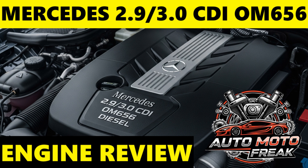Newer engine still maturing: as a relatively newer engine, long-term reliability data over very high mileages is still being accumulated, though initial reports are generally very positive. Camshaft and rocker arm issues: some reports on earlier OM656 engines, similar to the OM654, have noted instances of camshaft or rocker arm wear, sometimes leading to a ticking or knocking noise. Mercedes-Benz may have released revised parts to address this.